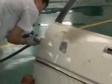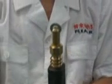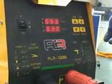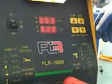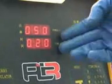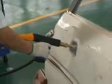After installing the cable, put the clamp to the vicinity of the welding part. Now, install the meshing electrode to the welding gun. Then, turn on the power switch and set the welding data. The recommended power is 50%, and the time is 0.2 seconds. The recommended power and time data is on the operational panel.